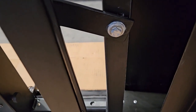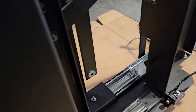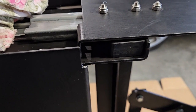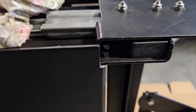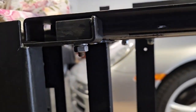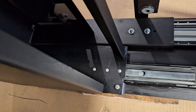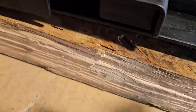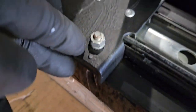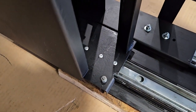The other thing I noticed is this block on the top step — it's not square, it's a rectangle. When I put it in, it was coming from underneath and lifted the rail up, misaligning the inner holes where those three rivets are. So I had to take it back out, turn the block around, and it drops the step down just enough to align the holes in the slide rail. Silly little thing, but that's why none of the holes lined up.